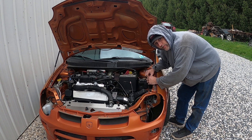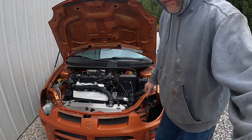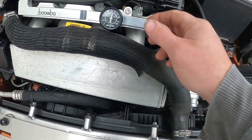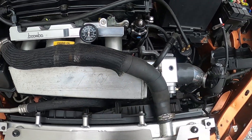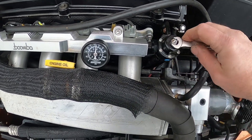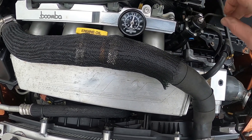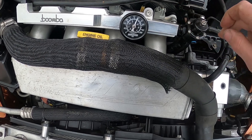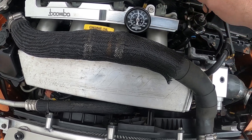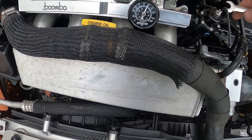With the fuel pump running, you can see the two spots front and rear. We're basically at 55 psi. You're going to want to loosen the lock nut. If I screw in, my pressure goes up; if I screw out, my pressure goes down. So we're just going to set this right here at 58 psi and lock it down.